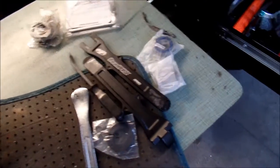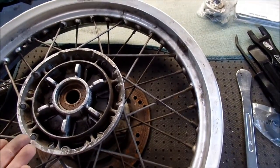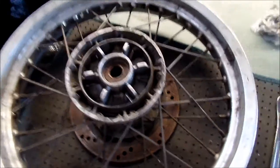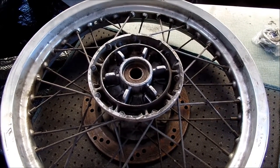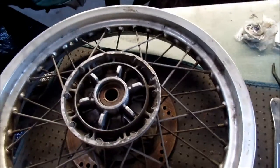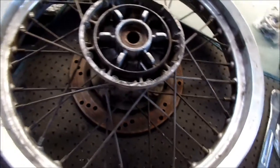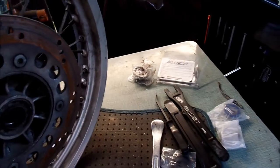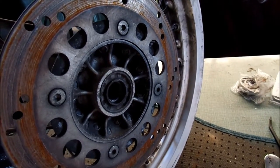So get your rear wheel, take it off the bike, and you have three bearings on it. What's on top of this is normally your sprocket and Cush Drive hub. You just take it off and take the Cush Drive rubbers off so they don't get in the way. Then you're left with two bearings — the wheel bearings on the rotor side, and then the sprocket side bearings.